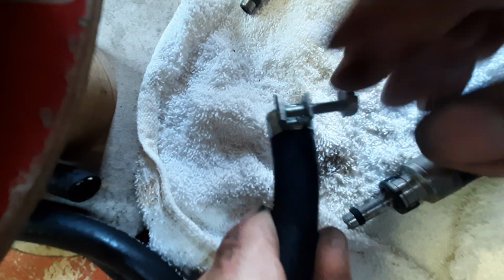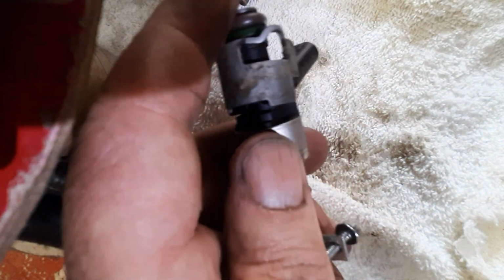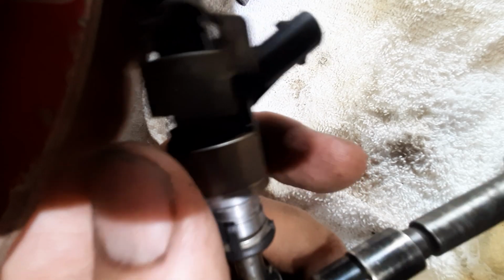In my case, 3/8 fuel hose, 3/8 high pressure clamp. Get it as loose as you can first. So when you're putting it in, be careful that you don't get it past the lip of the injector, because it's not gonna be helpful. So yeah, there, I just wedge it in so it's even with the wall of the hose. Got the injector sitting where it's supposed to. But I gotta do it off camera.